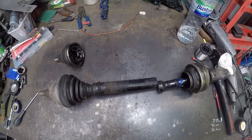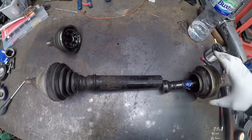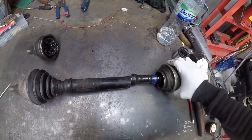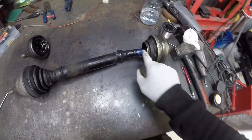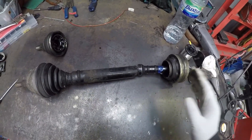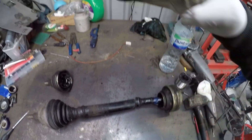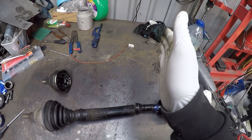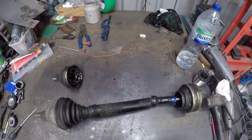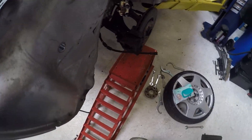So I need to work out the measurement at the position where the drive shaft is going to be at its shortest. When fully compressed, the spline is just touching the inside edge of the plate — that's when the drive shaft is at its shortest. That's the length I want to use, with the wishbone perfectly level and the wheel perfectly straight. Any movement from that point, the shaft will be able to extend.